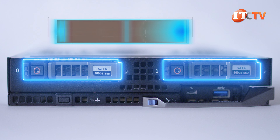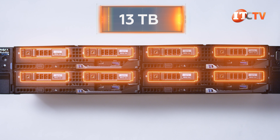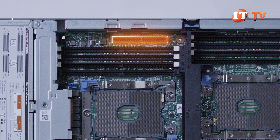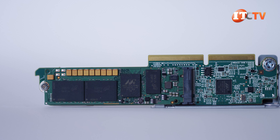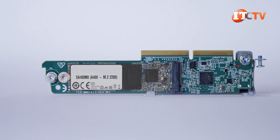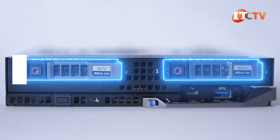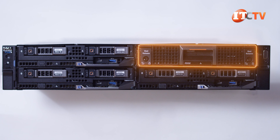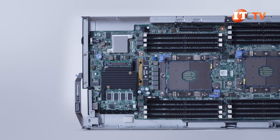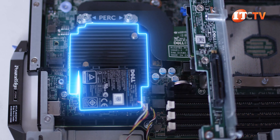Two 2.5-inch storage bays on the front of the chassis support SAS, SATA, or NVMe drives using a universal backplane. With both drives installed, it supports just under 13TB of storage total. Additional storage can be added using the dedicated PCI slot beside the memory module slots for an internal dual SD card module, usable by iDRAC for storage or to support a hypervisor. You can also use that slot to install a Boot Optimized Storage Subsystem, or BOSS — a PCI card that supports two M.2 NVMe storage devices in a hardware RAID for redundancy to support the operating system. For attaching more storage through the FD332 storage module, you will need an optional storage controller like the PERC H330 or H730P, the latter supporting up to 255 SAS or SATA HDDs or SSDs. There is also a host bus adapter option with the HBA330 for VMware vSAN environments.